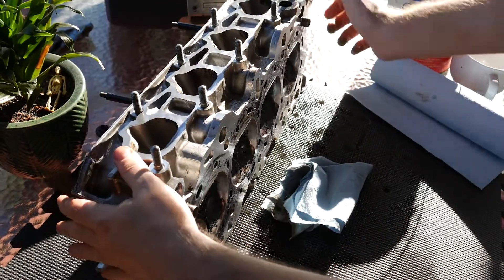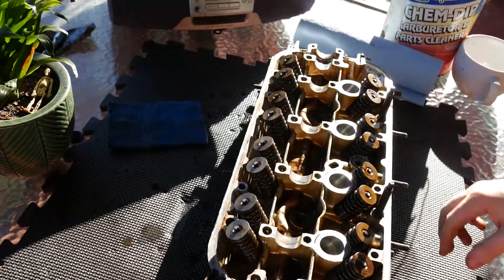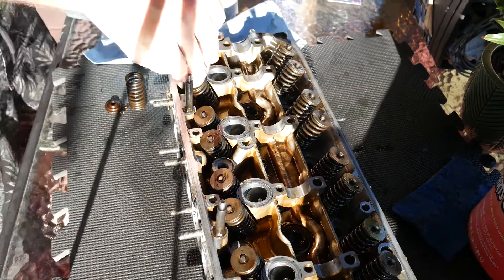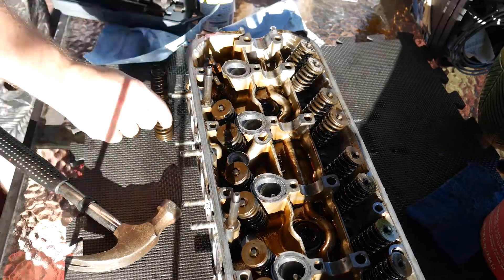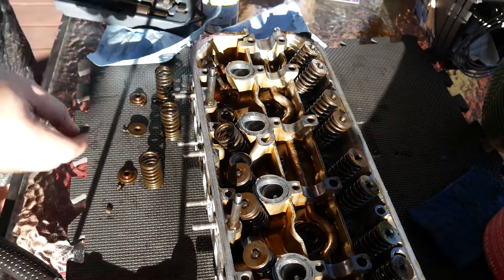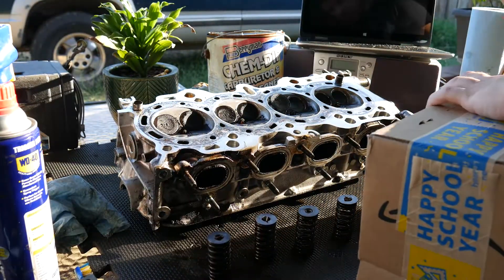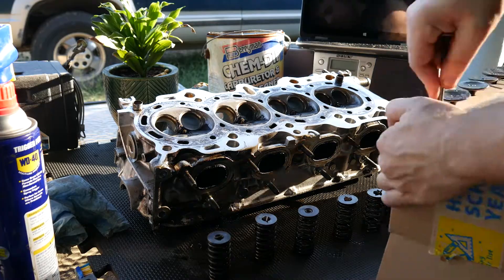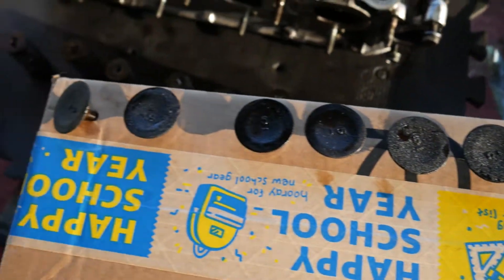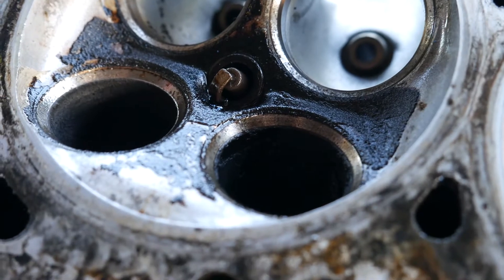With the third option I'm gonna have to completely disassemble the head — remove the valve springs. I got the special tool for it. I recommend this tool 100% and I'll leave an Amazon link in the description below, because I've seen people use some sketchy stuff that did not work out and they usually end up losing the keepers that keep the spring with the valve. So I'm gonna remove those, then the valves. Make sure you keep everything separated and categorized so you know where you took them out from, because this is a very old engine and you want to keep the exact valves in the exact spots you took them off — you've got to reseat them again.